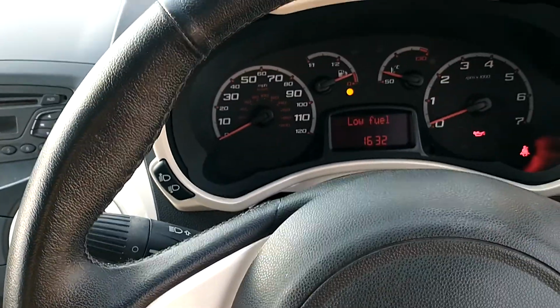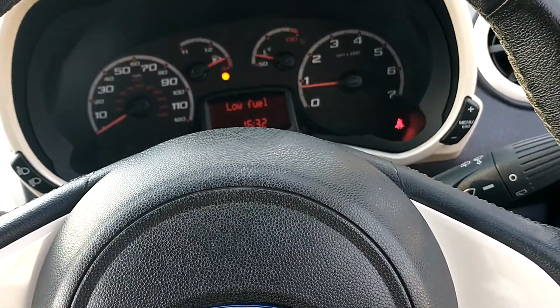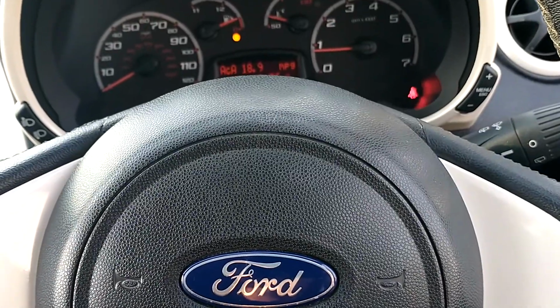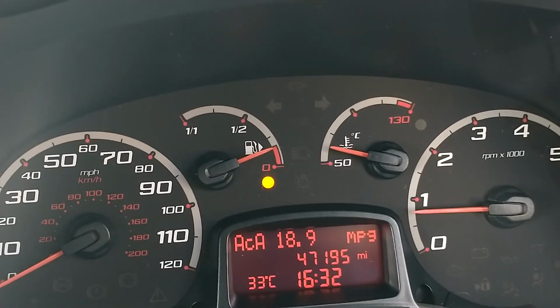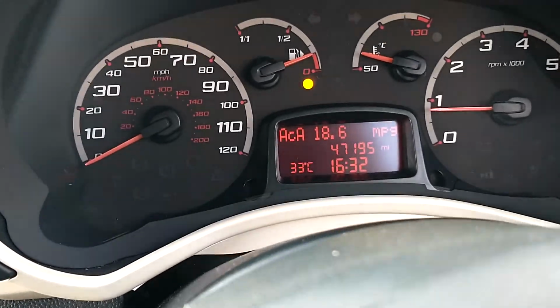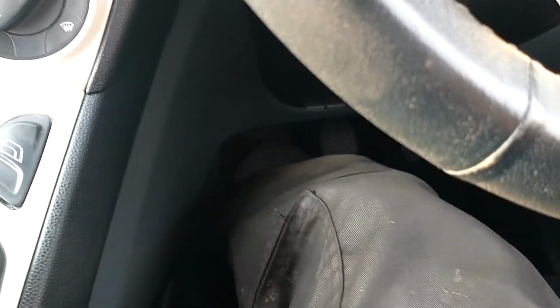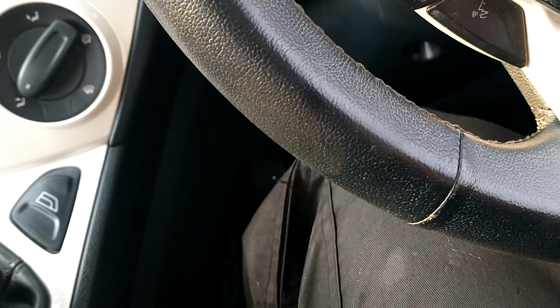Now we'd start the engine, listen for any strange noises in the engine. A great way to find noises that shouldn't be there is by pressing the clutch and releasing it. If you hear a different sound coming from the engine, like rattling or any sort of screeching noises, it's a sign that the clutch is worn out and it's on its way out. So yeah, that's not a good sign. If you do that, you should hear some little noise, but nothing whining, screeching, or rattling.